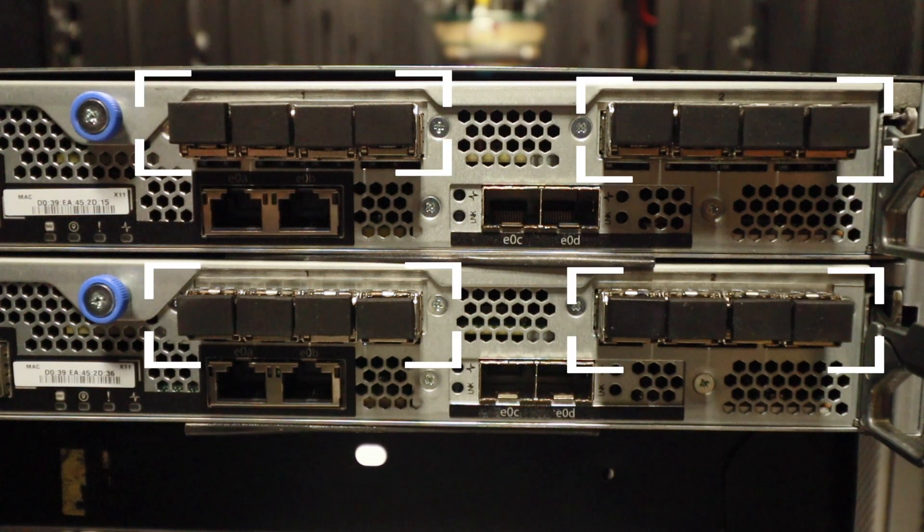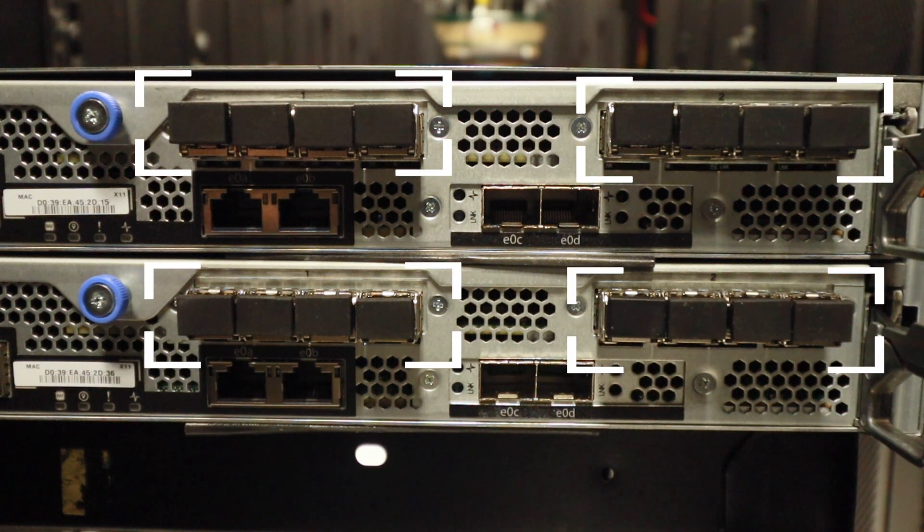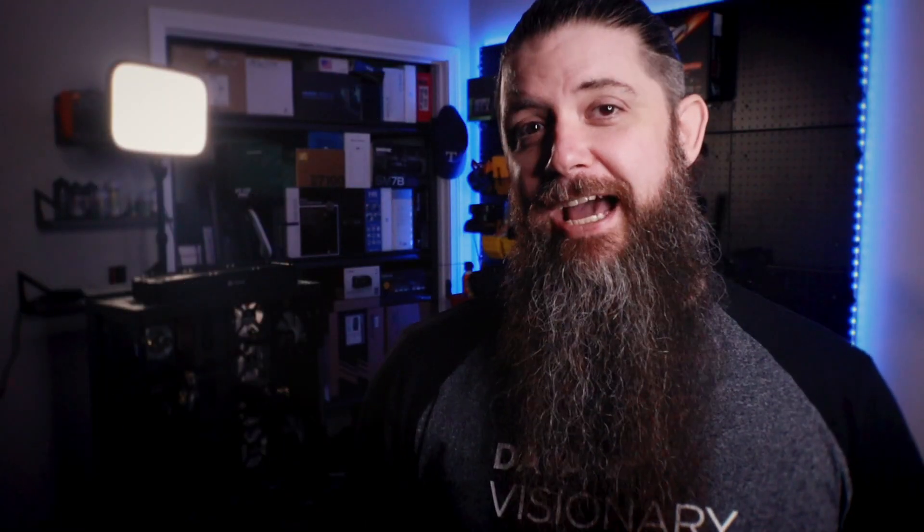When we look back at the A220, we recognize that having only four host IO ports on board was very limiting, and to swap those out required swapping out the entire controller. This is especially true when you're working with a 2U storage system where real estate on the controller itself is at a premium. So for the A250, instead of putting those IO ports on board, we leverage mezzanine adapters, giving you much more flexibility and options for how you'd like to tailor the array to interact with the rest of your data center. Each A250 has two mezzanine slots per controller to accommodate various IO needs.